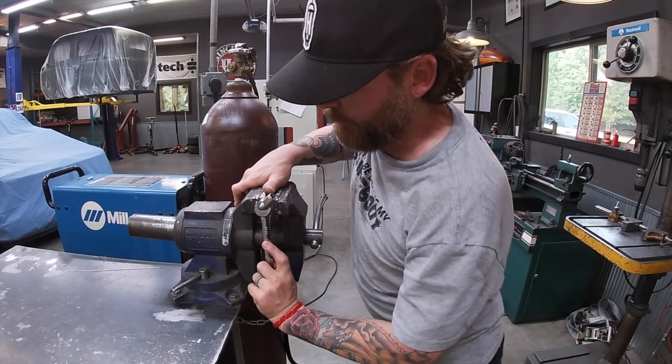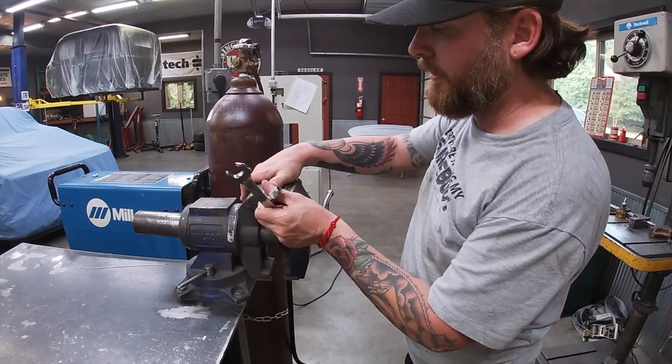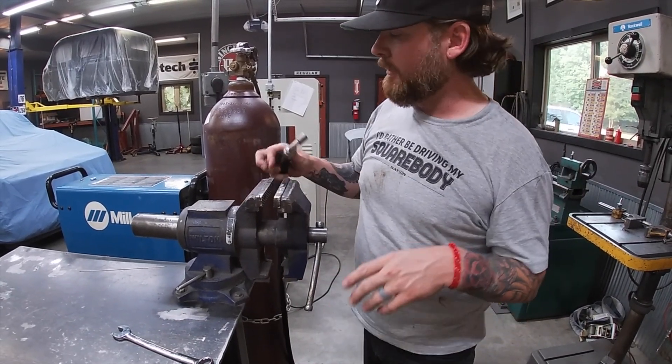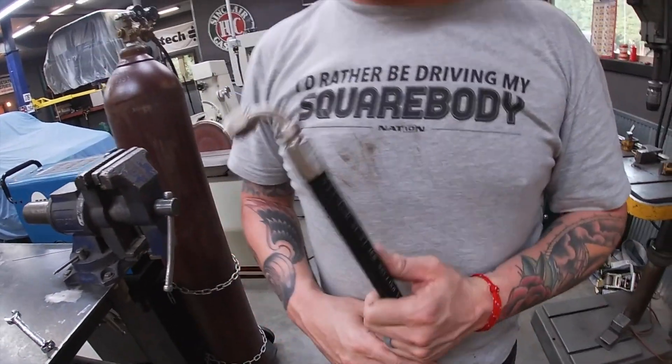You can see there's pretty good resistance on that last turn — you can tell it got tight. Steel wrench on steel fitting, aluminum tools on aluminum fittings. This side's done — we'll go ahead and put this in and measure our length.